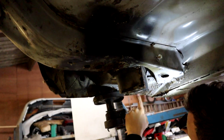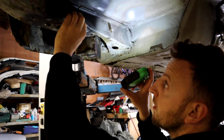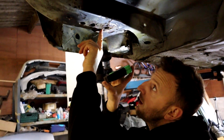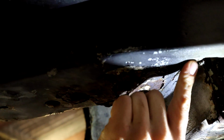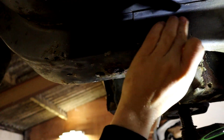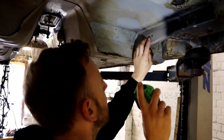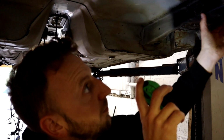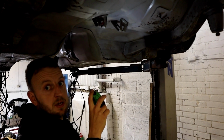We've been a bit more generous with the undersealer here, I think. So we'll have to drill the spots on that, get this panel off. So all I'm saying is, see that there? It's obviously rotted, and obviously we need to come back as far as we can to get rid of this rot, which is probably going to be to here. And obviously cut this here, which is obviously an easy part, drill the spots, but obviously that's in the way, so we're going to have to take them off on both sides. Obviously save this panel, that'll go back on after we've sorted that bit. I think that's going to be the plan, isn't it, Jack? See what I'm saying there, or am I being daft?